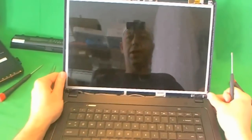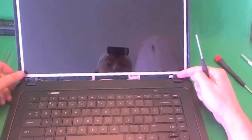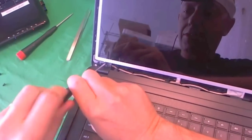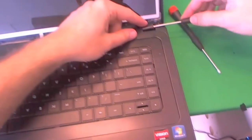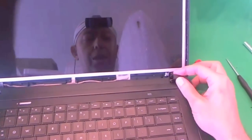This laptop is unusual in the way the hinge covers are mounted. You need to remove the hinge cover so you can tilt the screen assembly up a little bit to get to the screws on the side. For each hinge cover, there's a screw securing it to the screen assembly, so we remove those screws. We use our flathead screwdriver to work the hinge covers out — put it on the side and snap it off. When putting the hinge covers back in, you have to work them back carefully. Take your time, spread it out, and put it back in. It's a little tricky but it's doable.